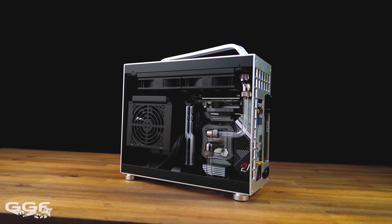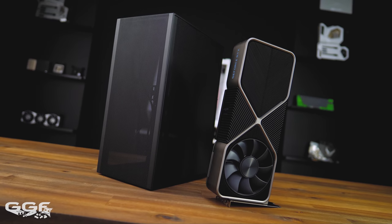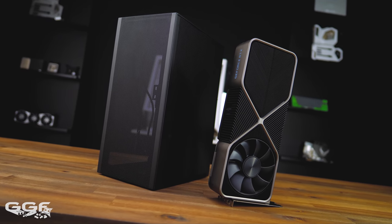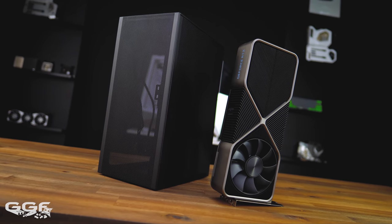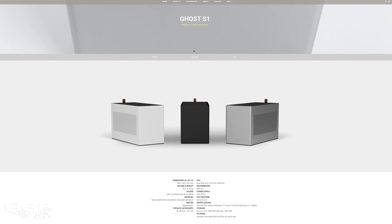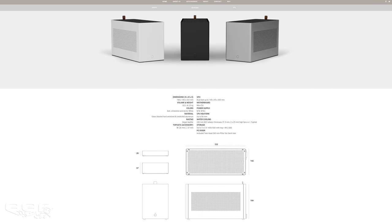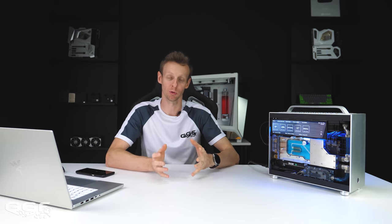That's basically it for my venture into this SFF build. I've had a lot of positive feedback so I've decided to do some more upcoming small form factor builds. I've got one coming up in the Meshlicious chassis - it has a lot of mesh side panels and one glass side panel - and I will be doing a CPU-only loop in that one as I'm using a 3090, since I wouldn't bother trying to water cool a 3090 and CPU in a case that can only hold a 240. And I've also got a Ghost S1 build where I'll be doing a top hat and a bottom hat, water cooling both the GPU and the CPU, because I can fit two 240 radiators in that one. Make sure you stay tuned for those, and thanks for watching.